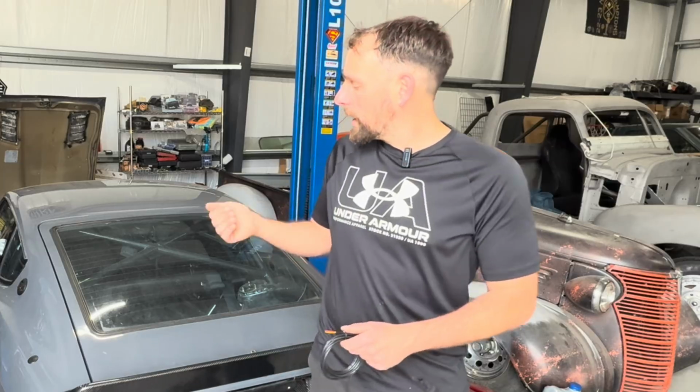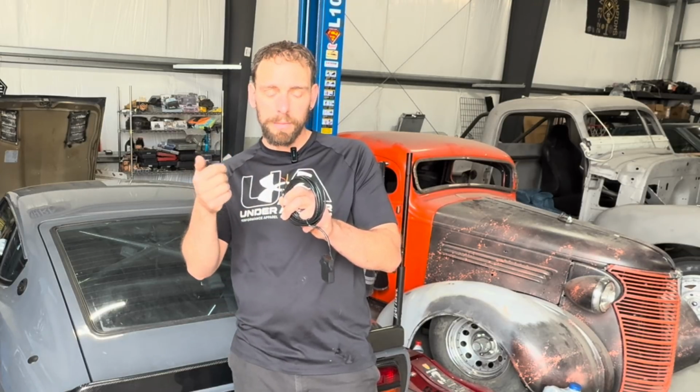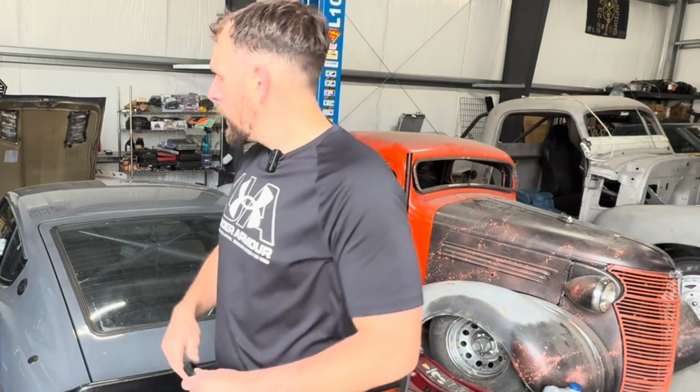So all I need to do is add a switch here. The red is switch, the black is ground. So ACC switch, meaning when the key is on. The black is ground and the yellow is the signal wire for the speed sensor. So I'm gonna go ahead and get that wired in. It shouldn't take me too long, and then we're gonna move on.